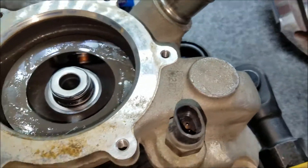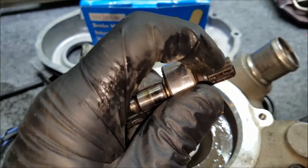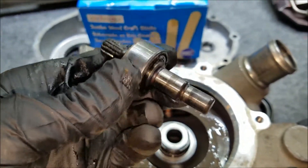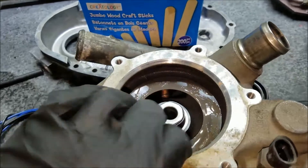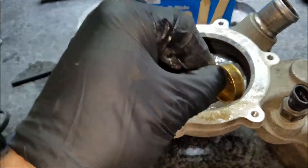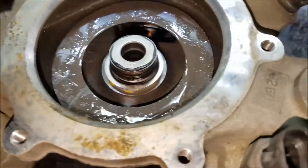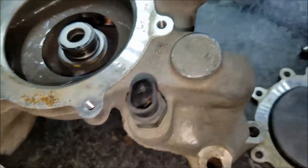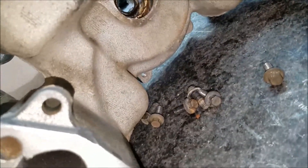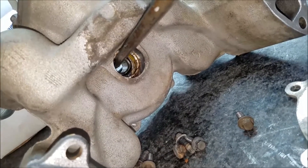Here's what we just punched out — this is where the impeller was. Here's the bearing and the drive gear from the other side. That's the hole we'll be plugging with the freeze plug supplied with the pump. You also need to punch out the seal; the best way is to put a screwdriver in and use a rubber mallet or small hammer to knock it out.